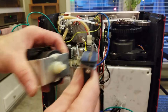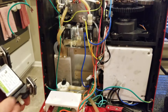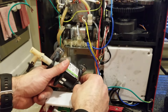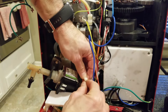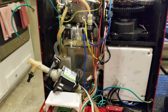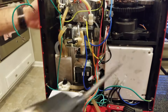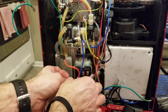Pull the bottom mount off the old pump and place it on the new one. Then attach the hose to the inlet and put on our wire tie. Get that on there and cut off the excess. Now we can go ahead and screw this guy in, then hook up all our electrical connections, put the hose on, and fire this up.